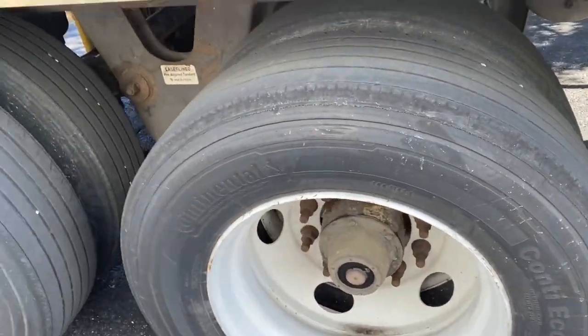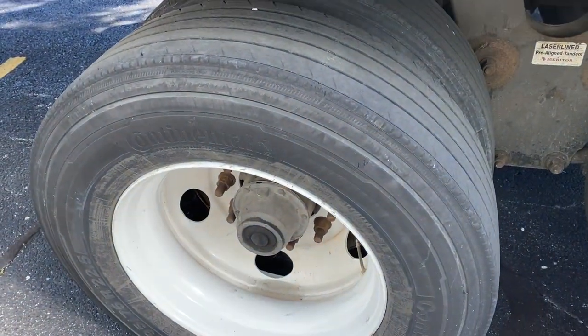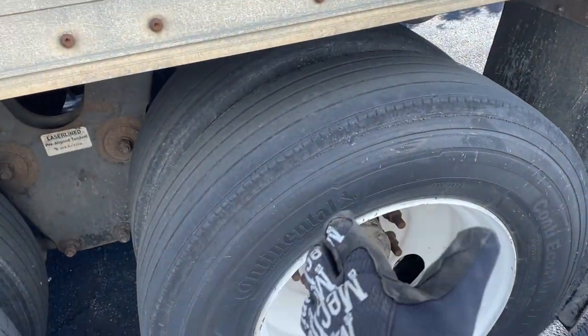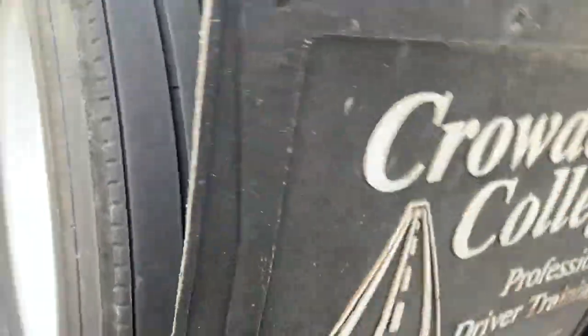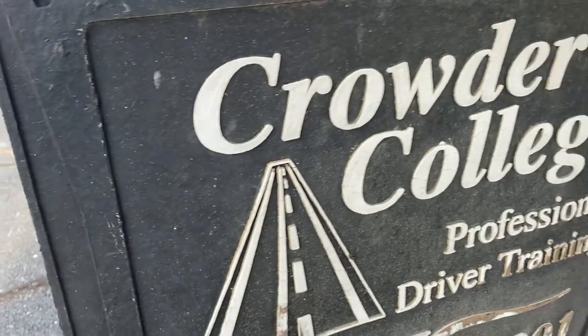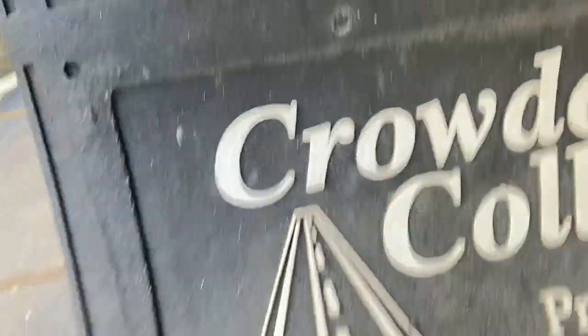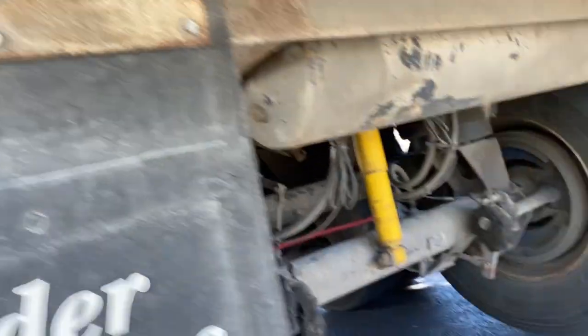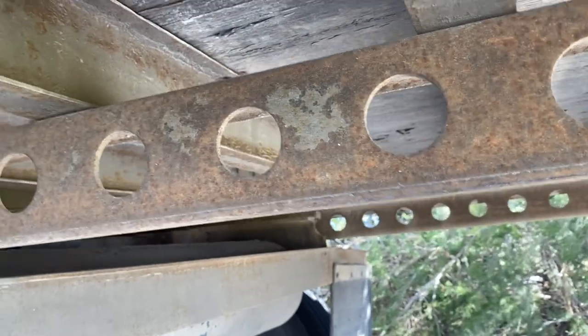For testing purposes you only have to do one whole setup — you don't have to do it again on the other side. Then come to the back — mention that the mud flaps are securely mounted, no bolts missing, not torn, properly mounted securely. Also mention the tandem slide — it's not cracked or broken, properly secured to the frame of the trailer.